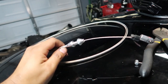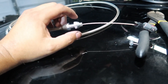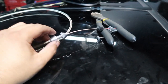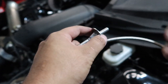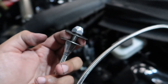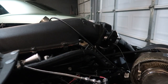So this is basically how it's going to sit, but we're not done yet. I actually have to take it right back out again because we have to put this piece on the firewall first. We need to make sure it's the correct length. The washer comes into play here — stick the washer through the firewall, put the washer on the other side, then put the nut on and tighten it all down. That's basically how it's going to sit on the firewall. All right, so take this old bracket off — goodbye to you.